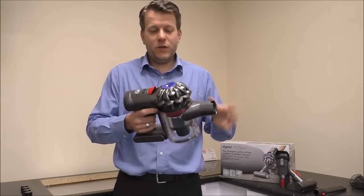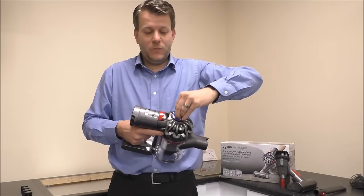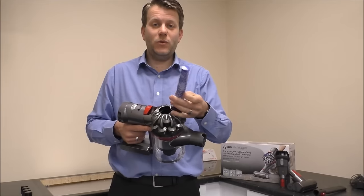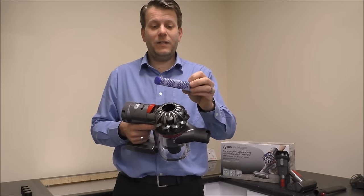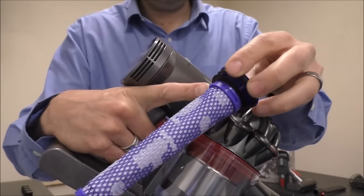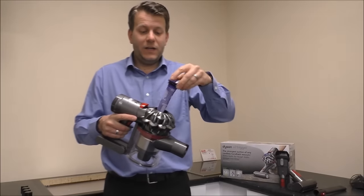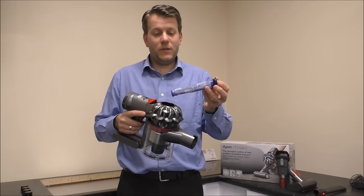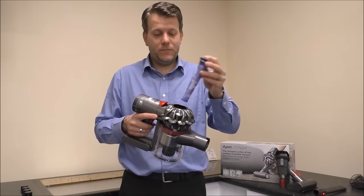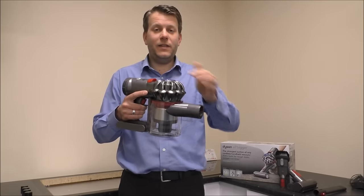The other main thing to show you, while talking about the cleaning, is the filter. On these, you've just got the one filter, which is just on the top there. It is designed to be washed, just rinsed under water — also let it dry properly before you put it back in. On this, you can actually take the filter apart as well, so depending on how dirty it is, just unclip this. What you can find, after you've washed it several times, is that you will need to replace it. These are available in lots of places and they're not very expensive at all. When it's dry, or if you've put a new one in, it just drops in like that.